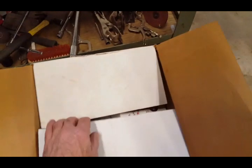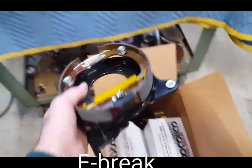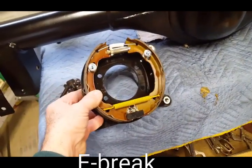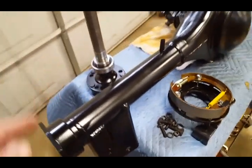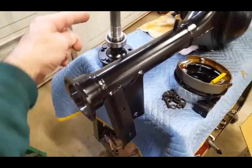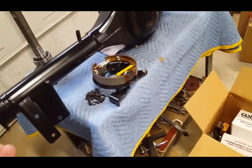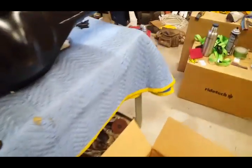I'm opening up everything from this brake kit. The brakes are already assembled on this kit, so all you have to do is remove the axles. If you're doing this on an older car that already has a Ford nine-inch rear, you would need a puller to remove the axle before installing these brakes. Since this is a brand-new rear, I can't show the disassembly, but I'll show you how it goes together.